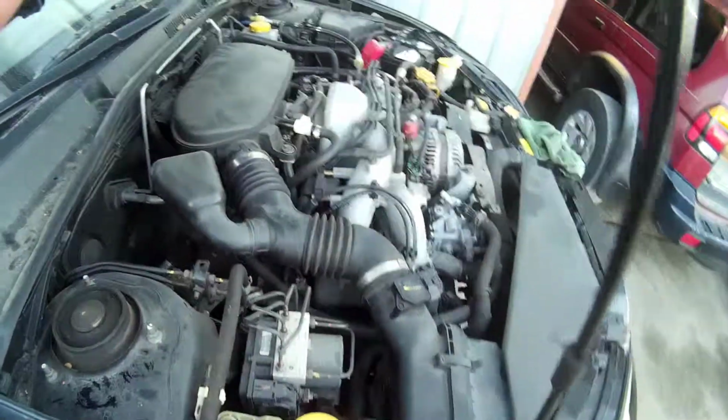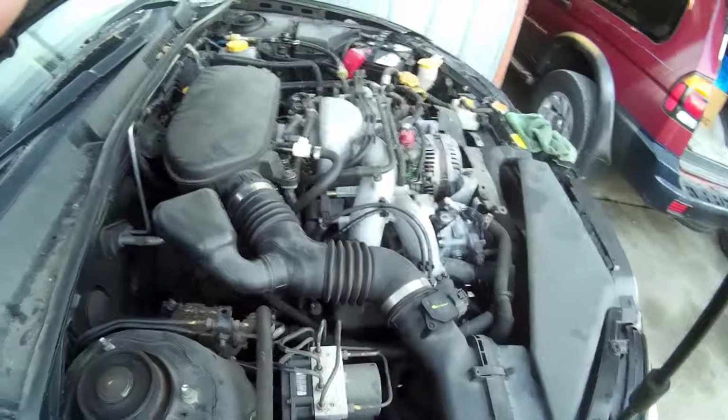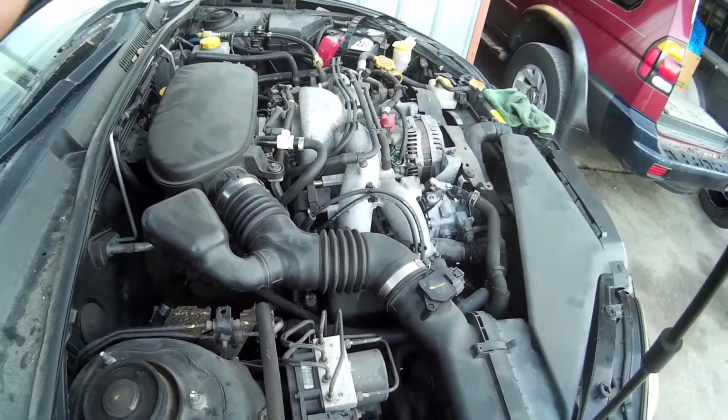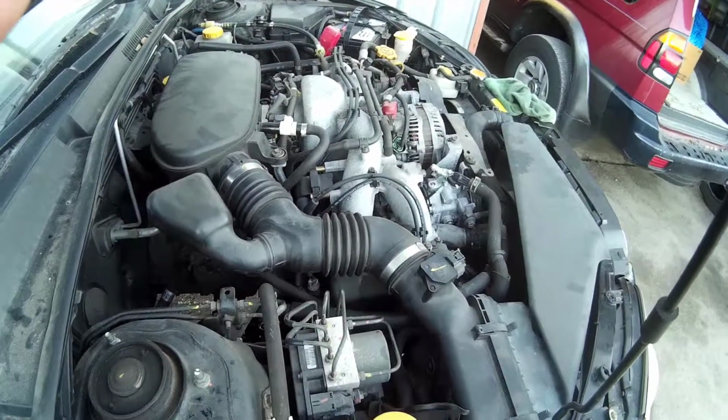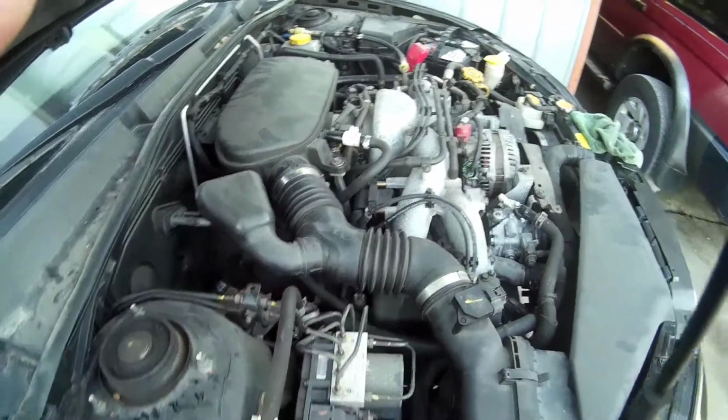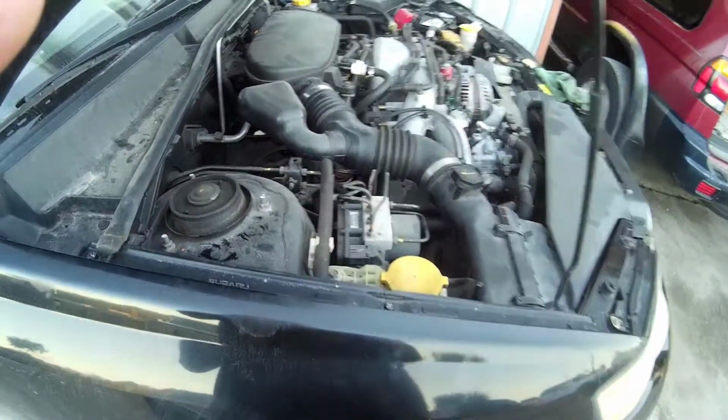The valves looked good. Everything looked good. I did a quick surfacing on it with some 800 grit paper on a long bar with some oil. Got it nice and true. And you can see, it runs smooth as glass. I'm going to let it run for a little bit, get the coolant circulating, put the heat on. And that's it. That ends this one.